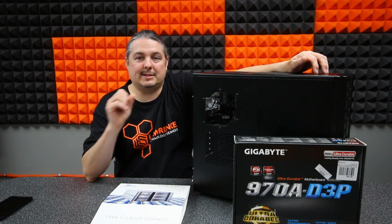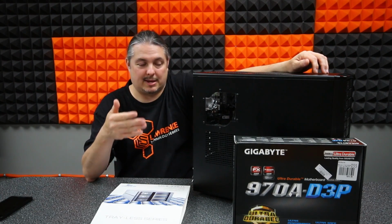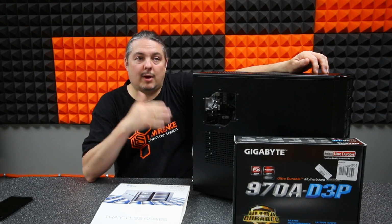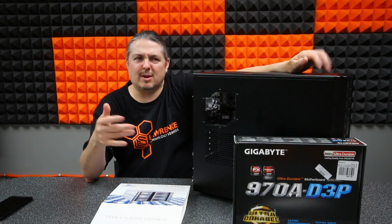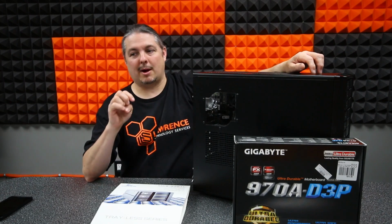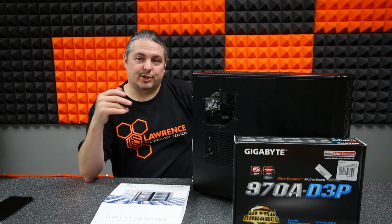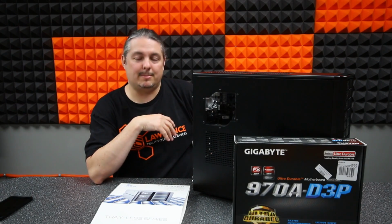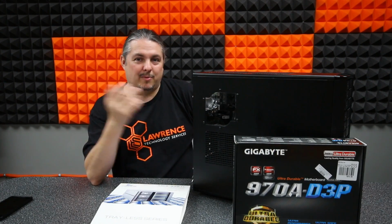When you put that in a RAID Z2 configuration, you come down to about 22 terabytes of usable drive space on FreeNAS. And the reason it was Z2 is you have an issue with RAID where, okay, I have at least 1 redundant drive. It doesn't seem statistically likely for 2 drives to fail, except this is the part you have to think about. If 1 drive fails, you have to rebuild it off of the data on the other drives. The stress of the rebuild could cause another drive to fail, and then the whole RAID array collapses at that point. RAID Z2 requires 2 drives to fail before the RAID array collapses.